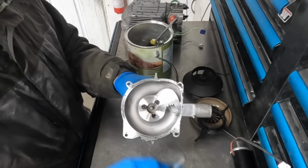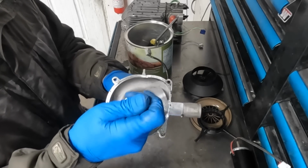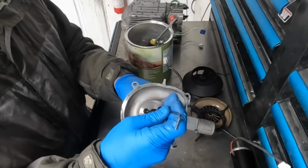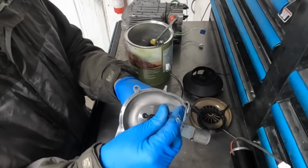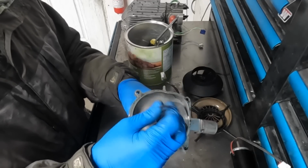I may have mentioned earlier that these were Torx. I was confused. The bolts that hold the motor itself together are Torx. The bolts that hold the motor onto the housing are 3mm Allen keys, although yours may be different.